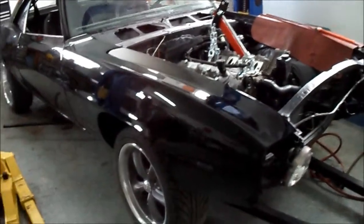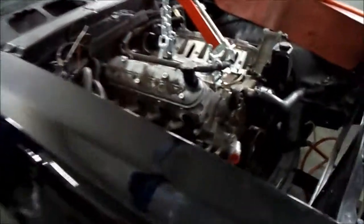Day two. Got the motor in. These are the motor mount plates that you just bolt to the LS block, and then the 350 mounts, stock small block Chevy mounts, and then the frame mounts. The issue that we're running into,